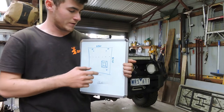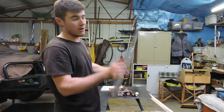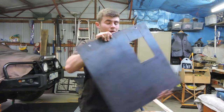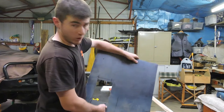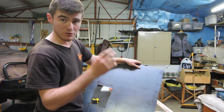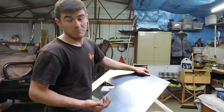I've made a bit of progress. I've cut out the bash plate and drilled in some holes. This is where the back cross member is, working towards the bull bar on this end. On that cross member I found center — there's a dimple with a hole that's pretty much center. From there I measured to where the two outermost holes were on the outside edge. These holes are elongated because I mucked them up about 3mm out, so I just made them a bit longer and it works fine.